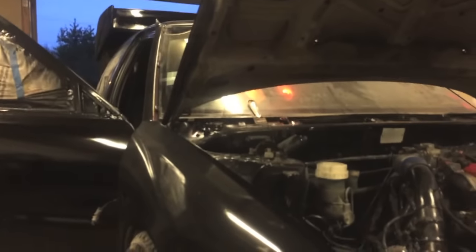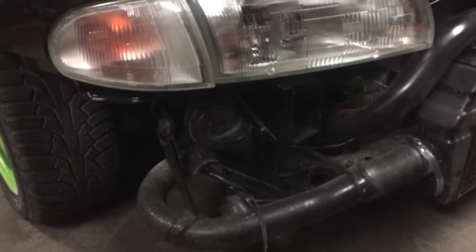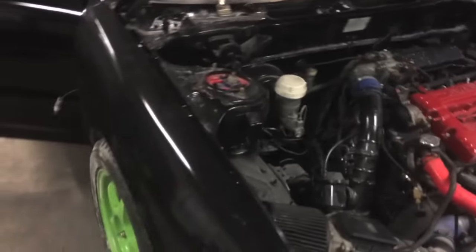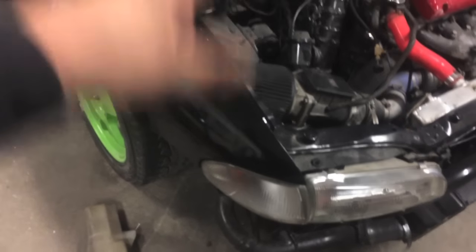So it was just basically this wire was inverted with this one. And I found what wire goes to the horn. I tried running the horn before. Basically, the way I had it set up was two BMW horns. And I put the ground, and then I thought the steering column would bring positive to it. It's actually the opposite. So there's always positive going to this. So the original wire that I ran negative to it, instead I put to a positive, which is that. I'll show you the fuse.